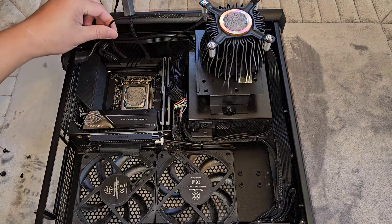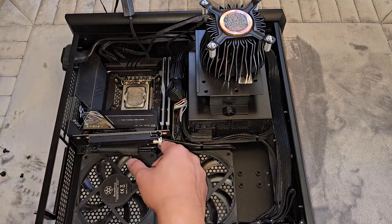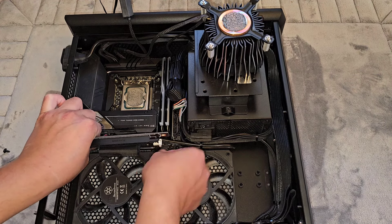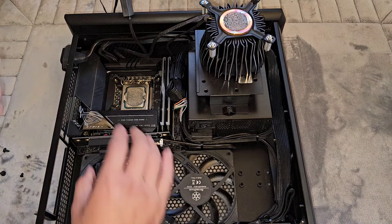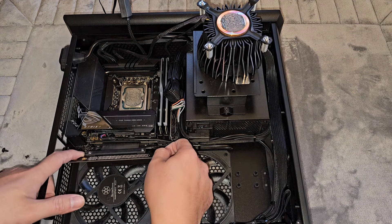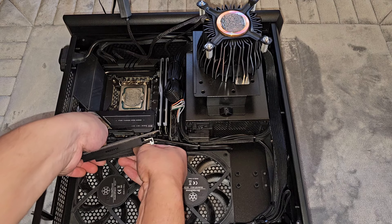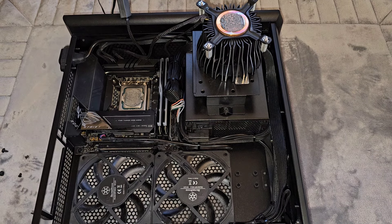We also have these small fans we're going to swap out for larger fans. Let's pull this connector out — push the latch down and remove it like a regular PCIe card. I don't think there are screws holding it, but it's hard to see back here because it's so cramped. It's holding really strong. I need to get a closer look — let me move the animals. I don't see anything holding it down, it's just very hard to rip out. Had to wiggle it a lot — there we go, got the PCIe adapter out.